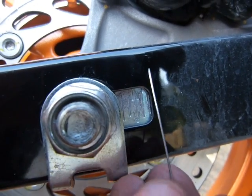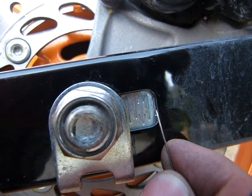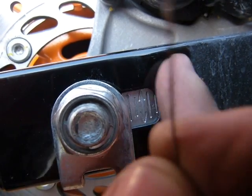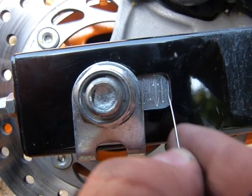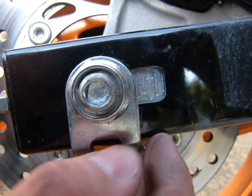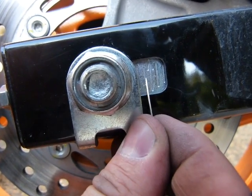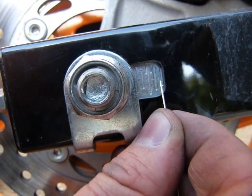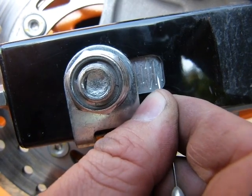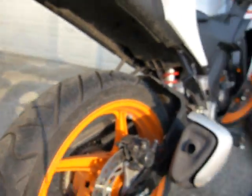Wait for the camera to focus. This is the reference line that gives me a good indication, and this edge on the swing arm where the swing arm in the middle is cut open — there I can see the position of this line and the exposed amount of metal in front of it. Don't worry about the wobbly washer because which line the washer lines up with is inconsequential and irrelevant. That is the surface you need to watch — this part on the swing arm and one of these lines, or the distance between the lines, whatever is exposed from this edge on the black swing arm.